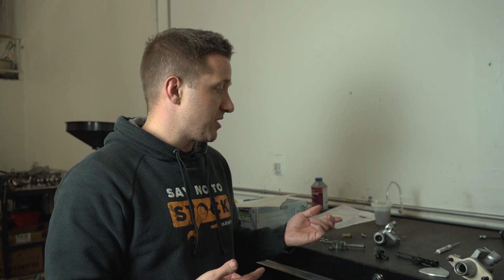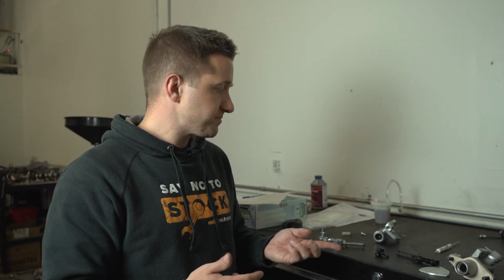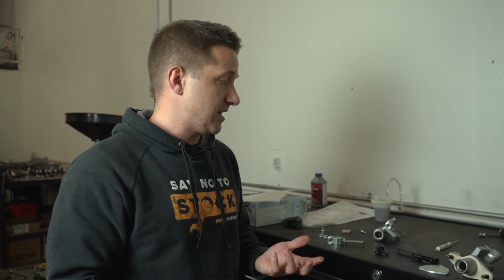Hopefully that's it. Maybe there's something about the master cylinder I'm still not understanding, but we're gonna put it back together, throw it back in the car, and see if the modification to the slave cylinder did what we needed it to do. At least we're only changing one thing so that we can see truly if that might work or not. If it does, then I think we're good to go. So let's cross our fingers. We're going to throw this stuff back in and try to start up the car and see if the clutch improves at all from here. So I'm about to do that.